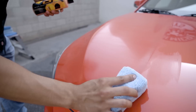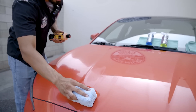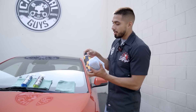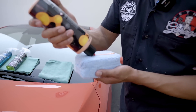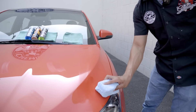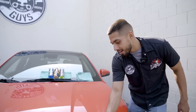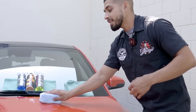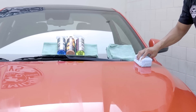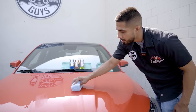Especially on light colored cars like yellow, orange, and light blue, it's going to give a super warmer shine. On dark colored vehicles like black, dark silver, and navy blue, it's going to give a much cooler shine. To apply it, shake up your product to get everything properly mixed in. Then grab a microfiber applicator — just like HydroCharge — and apply two lines onto the applicator. Work it in linear motions; Hybrid VO7 goes on with no type of elbow grease. Hybrid VO7 can also be applied on multiple surfaces: paint, glass, headlights, painted trim, chrome, and even wheels, so you can bring out the most shine and reflection on all those areas. After working one area, do the cross-hatching pattern to get an even spread, work it side to side, and do this process around the whole entire vehicle.